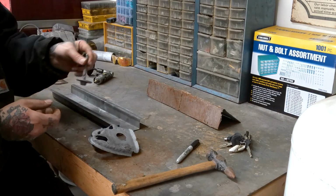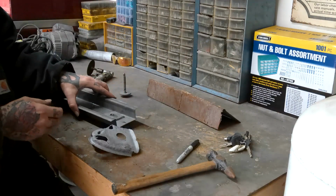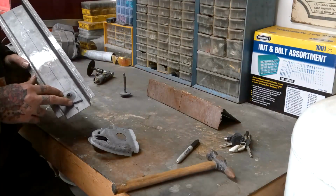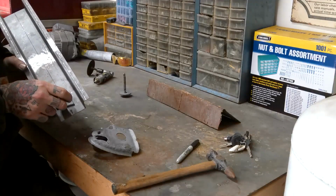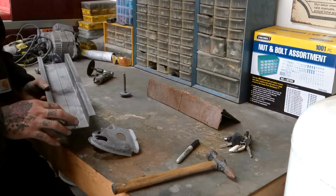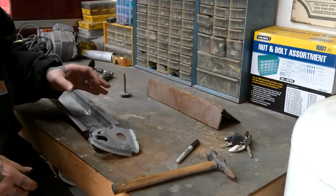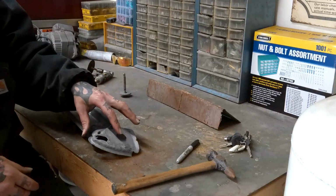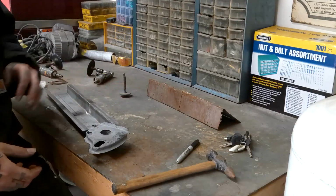This piece here was a pain in the butt to get disconnected from the actual bolt. So this little diamond piece goes in here. And normally it has this little metal cage around here that allows this to move around and get your adjustment. Since I have the floor open, once I figure out where the hole needs to go, I'll get the hole drilled in there. I'll put this piece in here. We'll bolt the body mount stuff all back together so that it's part of the car, and I'll just weld that in.